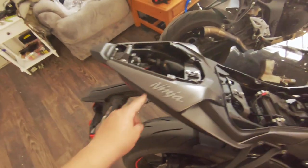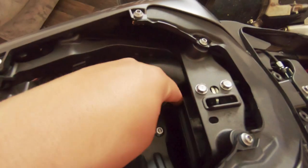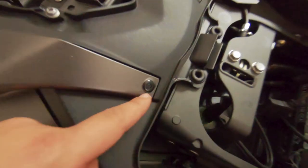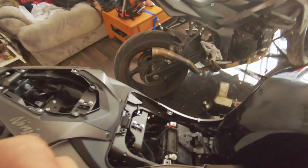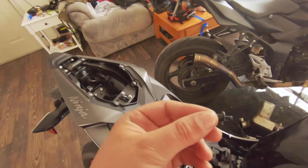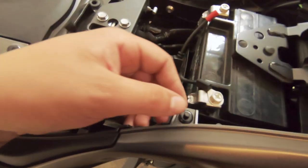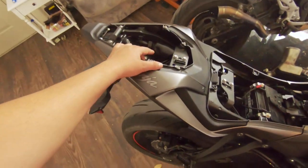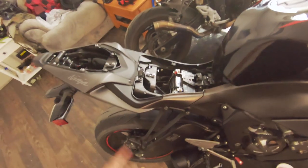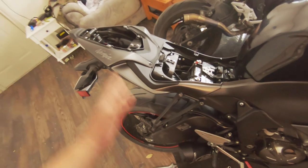Fairings are almost fully buttoned up, everything put back in. The servo buddy I ended up connecting right here — there's a little pocket in there where I just sent it down that way. It's not that long, just so that it's tucked out of the way and the wires aren't getting bent or snagged on anything. We also have a lot more trunk room now. The last thing I wanted to show you guys is these pop clips right here. You've got to push the centerpiece in with a flathead, and then you can pull them right out. To put them back in — once you have them out, you can push it out the other way, leave the tip coming out, line it up into your hole, and just push in until it snaps. That's not going anywhere. So fairings are on, servo buddy's on, only thing left is the seats.